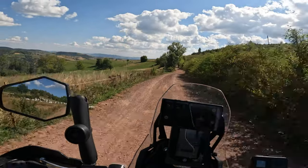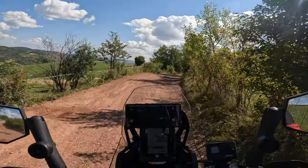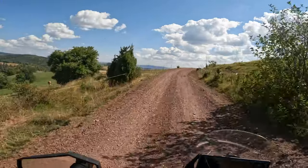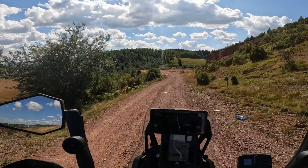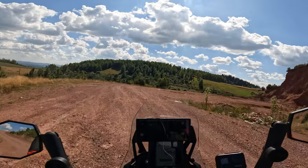Basically, this would be it from this video. I don't want to spread this story more. Maybe think in the direction, if you only ride off-road, of testing Mitas E09 as a cheaper variation of the Dunlop 908, because that tire is expensive. Also for the front one, it can be Mitas E13 Rally Star, and these are good variations. I would go with the rear one to be Dakar, with the front one to be Rally Star. It will be a good combination for 70-80%, even 90% off-road riding, 10% tarmac.